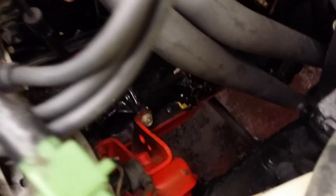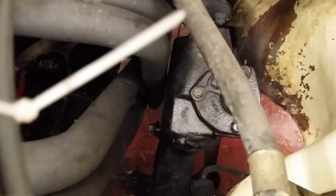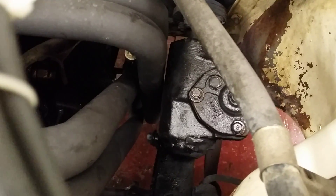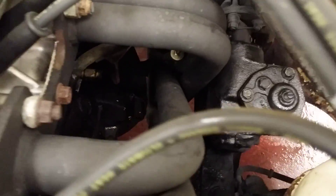I painted it up a little bit — just kind of nice, not too much — and then of course I scratched it all up getting it in. I had to pull things in and out a couple times. I'm not sure of the brand of the headers yet, probably just some cheap stuff, but I did have to modify them a little bit because they were hitting the steering box. Sorry about that zip tie — you can see that little gap down there. I actually had to flatten them a little bit, and they hit something on that side so I got it pulled over right now.